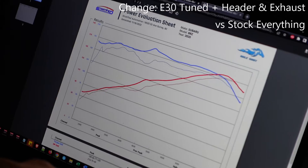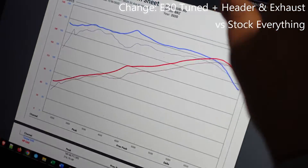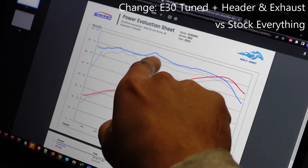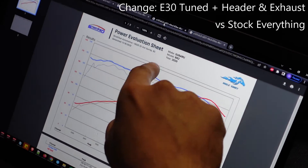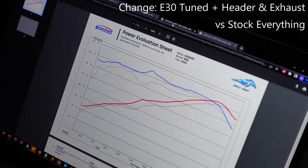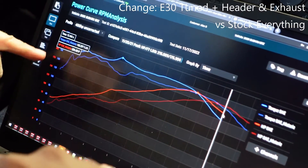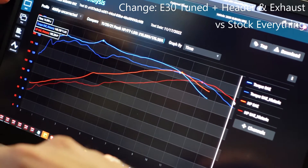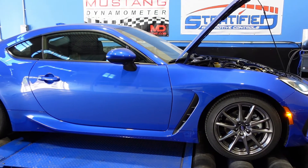Now let's go back to the very beginning — a comparison between the tuned car on E30 fuel and where we started with this car when it was bone stock: bone stock tune, bone stock headers, bone stock everything. We made power. Most notably there was a slight torque dip from the factory that's still there, but putting on the unequal length headers changes all that around — instead of a torque dip you get a torque hump, which is more satisfying to drive and makes power everywhere across the board. In terms of acceleration, we're looking at about 12.5 seconds for a full fourth gear pull on the E30 tune versus just over 14.1 seconds stock. The car is going to be significantly faster, especially for a naturally aspirated car, when you throw on these parts and tune.